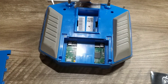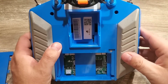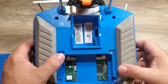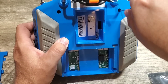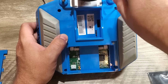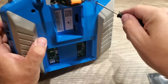We're going to go ahead and remove this battery, take it out of the way. Now you can see, with the battery tray removed, we have two Phillips head screws there, and once we take these two Phillips head screws out, the back of the radio should just pop right off allowing us to get to the circuit board so we can go ahead and do this modification. Let's go ahead and remove these two screws. You just take a small little Phillips head screwdriver. They're in there pretty tight, so make sure you get a good grip on them. Now, if you have the battery tray in, there will actually be two more screws at the bottom, but I've already removed mine, so that makes it a little bit easier.